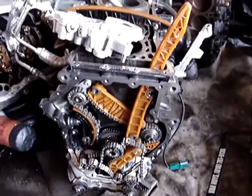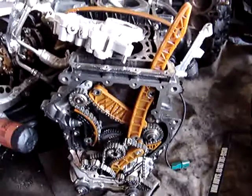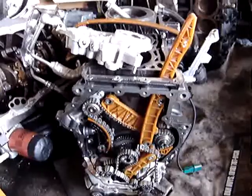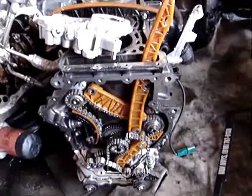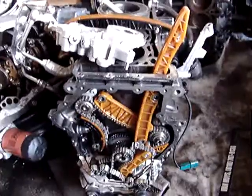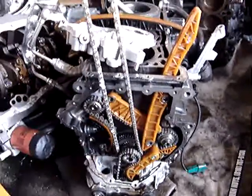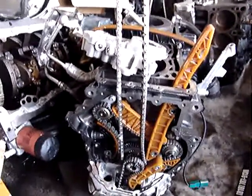This is a very complicated timing chain setup. First order is to mark your timing chain and timing sprockets — you do not want to lose the position of your timing chain on the cam sprockets. Before you remove the cylinder head and the timing chain, make sure you mark the timing chain on top dead center, and mark it in relation to the cam sprockets and other sprockets.